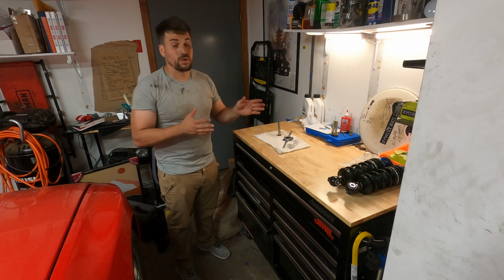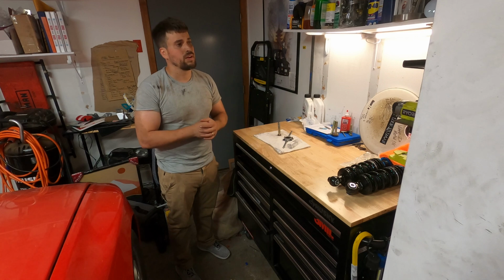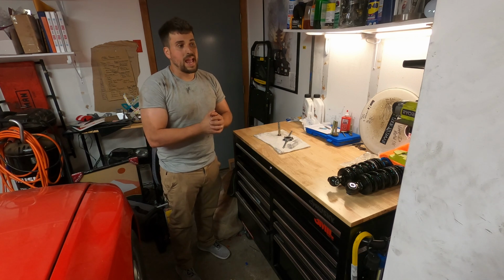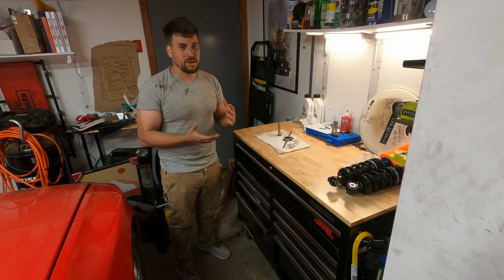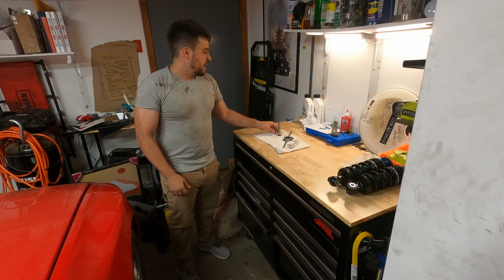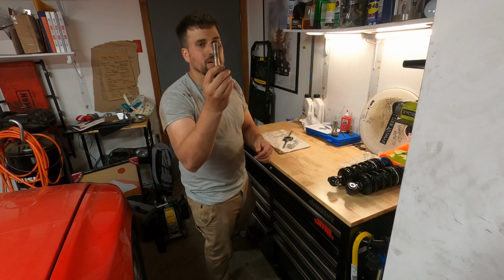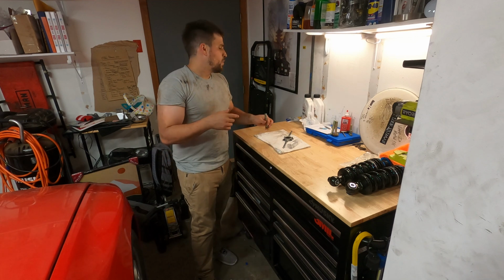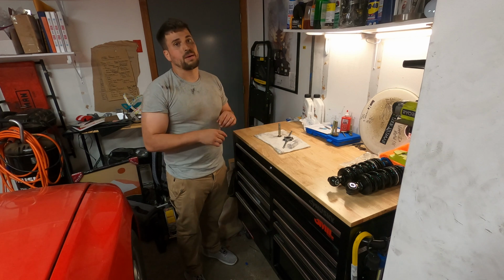I was taking out the rear factory suspension when I was starting to pull it apart. I just used my new impact wrench with its beefy new battery and pulled out the rear bolts, and they were hard coming out. I should have known to stop and think about it, but again, probably on an hour, maybe 2 hours of sleep, and I just ripped it out. And what I found was I gacked the bolt pretty good, which means I also gacked that aluminum trailing arm pretty well, where the hub is and where the bottom of the suspension bolts to.